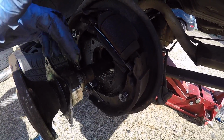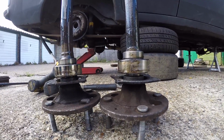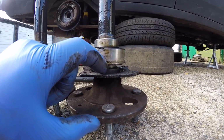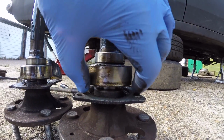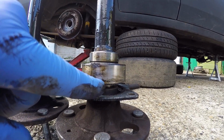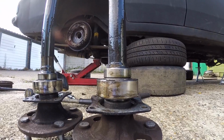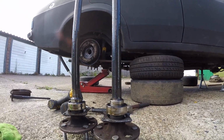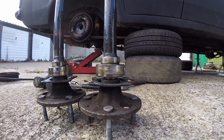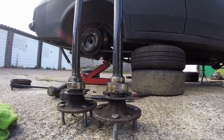And the bearings that I've got on these half shafts at the moment do leak, but I'll just put some sealer on once I put it back together. Now, I was going to try and show you the difference between these half shafts. This is the one that I thought was longer from there to there compared to this one, but it seems like this bearing isn't fully seated. I might be wrong, but it definitely looks like there's a gap between the bearing and the shoulder that I'm guessing it's supposed to lean against. So I don't know if maybe I can get hold of a scaffold bar and then use that to slide over the shaft and then see if I can whack that bearing down a bit further. Because if I can, that means that these half shafts are identical, and then I'll just need to change the bearings at some point, which would be better.